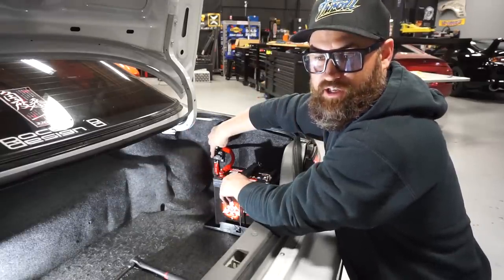Well, that was a successful test. Okay, well, that's good news. We kicked the breaker on and we have the alarm going off. So that means we're getting power from the battery to the equipment in the front. So we're gonna go ahead and do a quick multimeter test and make sure we're getting power at all of the locations that we needed at alternator, distribution point, and all those places.